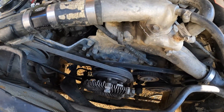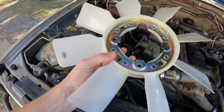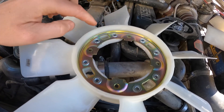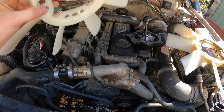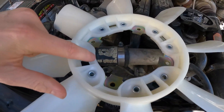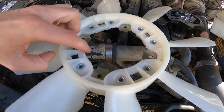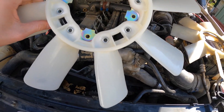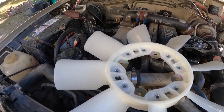The main reason you'll be watching is because of this fan - apparently it's a slightly different PCD by about one millimetre, so you've got to file these out a tiny bit and maybe massage a bit of the plastic here. I said use a Dremel or something, but I'll just have a crack at it with a grinder and a couple of files and see how we go.